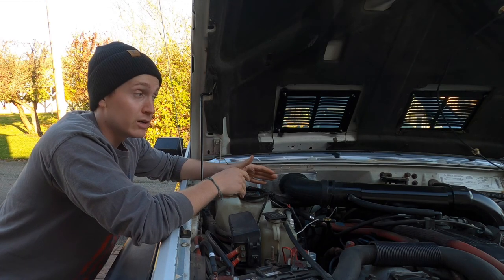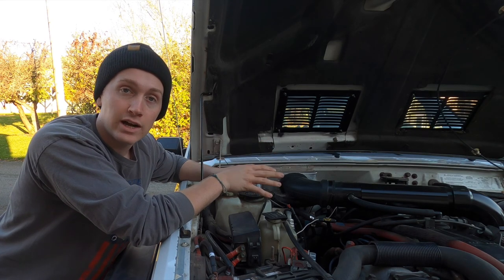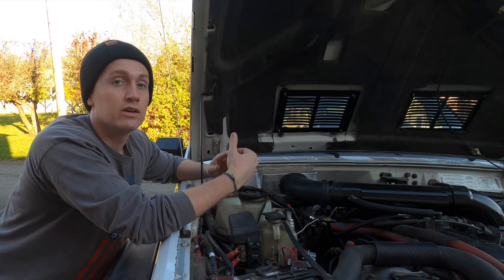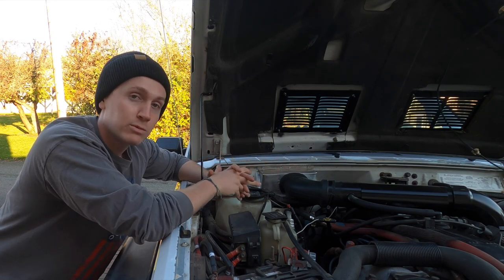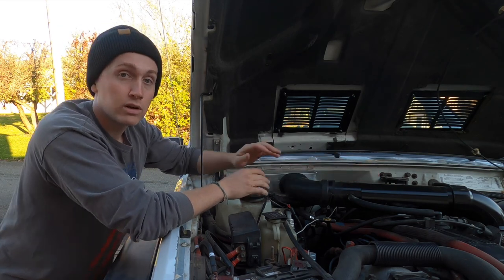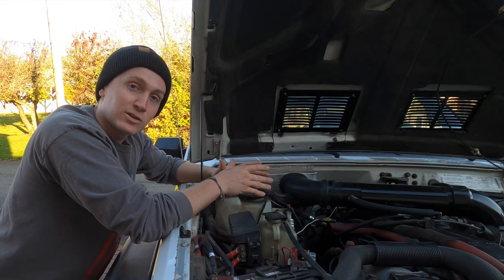Some people are concerned about the plastic melting. Now, I got CPVC, which is chlorinated PVC, much higher temperature, but 200, and the Jeep's supposed to operate at 210. Some people think that's going to be terrible, it's all going to combust and burn down your engine. 3 months, I've had no issue. Plenty of people will verify they've had no issue with that. I also had the aluminum heat shield I put on, just to kind of keep a little bit of heat from directly above the engine off of that. I really don't think it's going to be an issue.